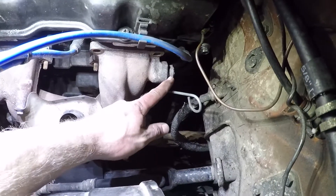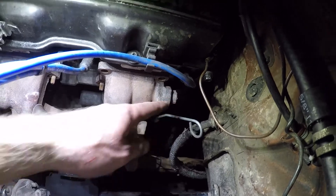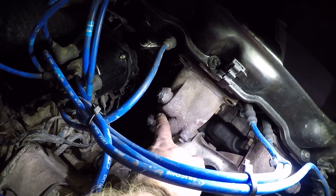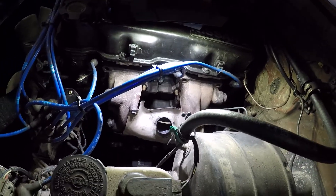If you have an EGR installed, you want to remove that on the intake manifold side — it's frequently easier to get that bolt off there. If you have a warm air assembly, you'll just need to unplug that from your warm air intake side. Now that I've got all that stuff removed, you should be able to just lift this manifold out of here.